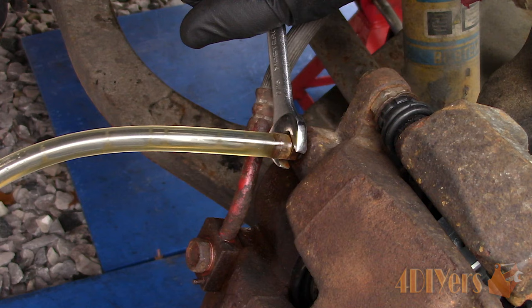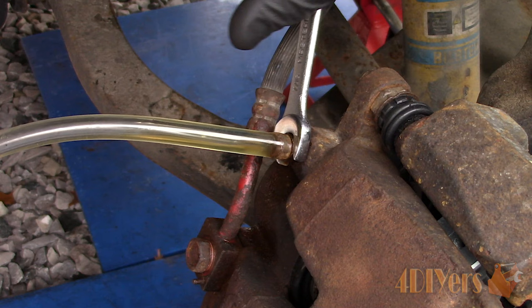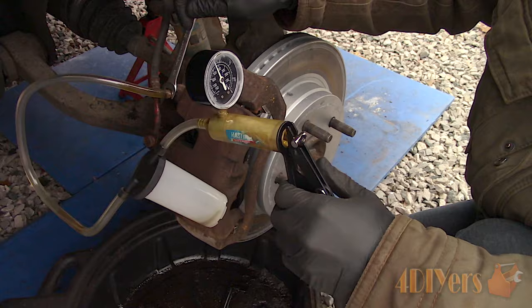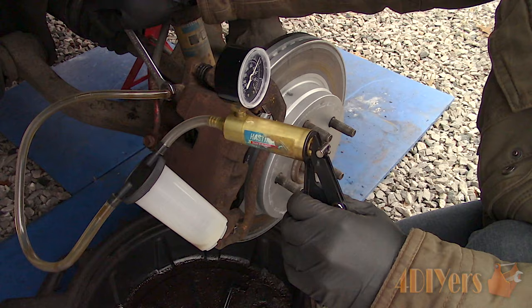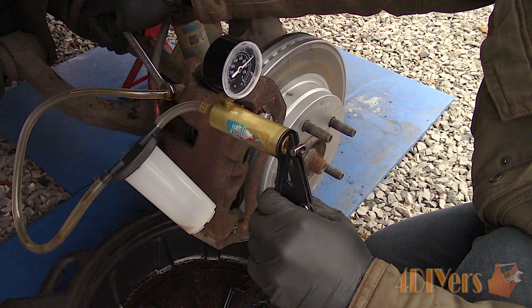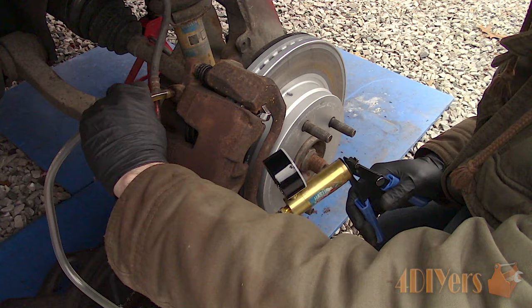Considering the truck is also new to me, the fluid does appear to be older, so I've decided to flush the front half of the system while I'm here. Vacuum pumps can be used for removing old fluid too. Brake fluid when new will have a light golden color — as brake fluid gets older and components deteriorate, it'll become discolored. You'll notice the change in color between the new and old fluid when watching the extraction. The amount of fluid removed varies depending on the work: if a whole line was replaced from front to back, more air would be present. Make sure the cup doesn't become overly full where the brake fluid gets sucked back into the pump, so drain as needed.